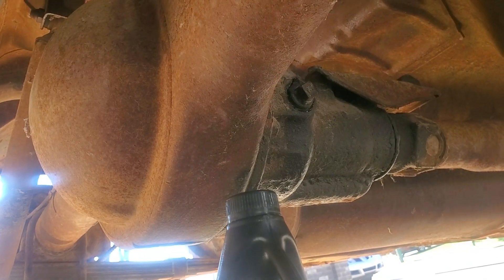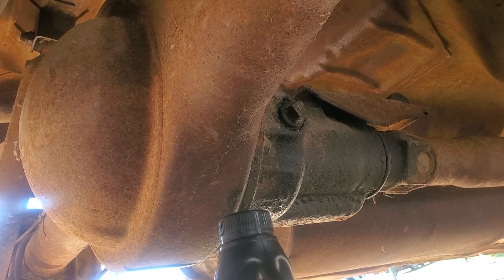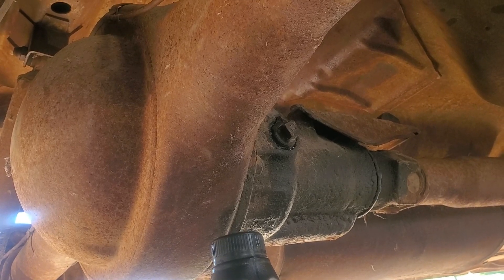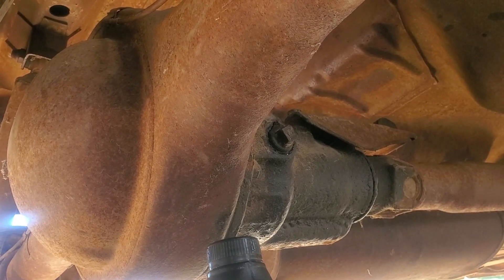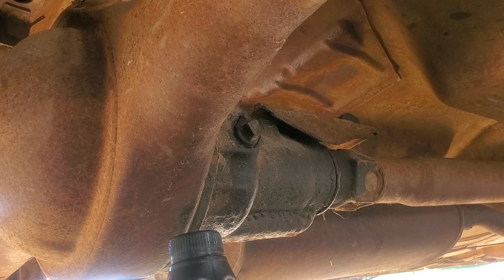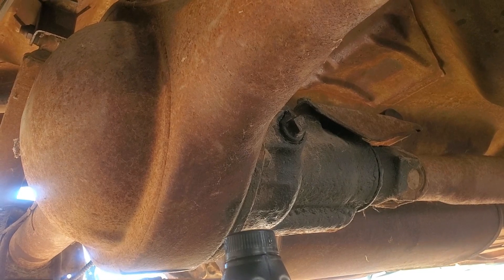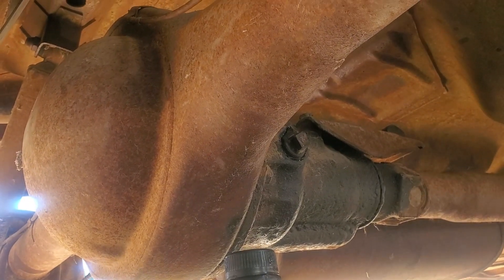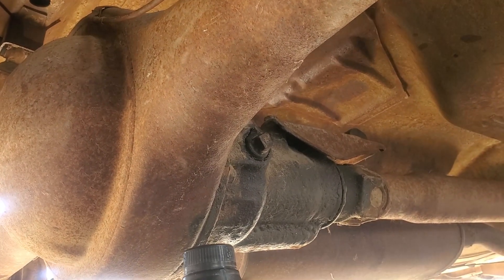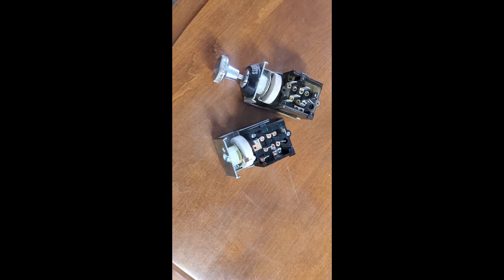While I was underneath here today I figured I'd check the oil in the differential. I pulled the plug out, put my little pump in there and pumped out what I could. The oil looked more or less brand new - still golden, no junk in it at all. I drained out what I could. I think that front seal's been leaking for the last 50 years, but the oil looks brand new. I managed to put two liters of gear oil back into the rear end and it's full, so I'll just watch it for now. Down the road I will replace that seal.